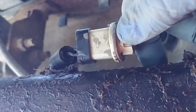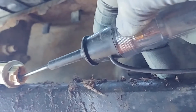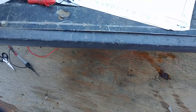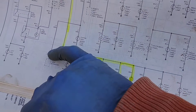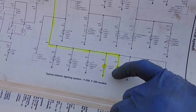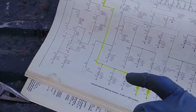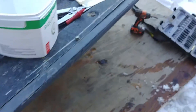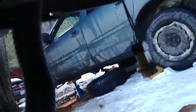Let's go to the other side and read from the brown wire, which is the bottom one. Nothing — dead. We don't have a power supply. What we're doing next is going up to the distribution where the splice is. The circuit is connected there, and because we have power at the other lights, somewhere in this area there is a break on the power side. I already found what's wrong, but I'm taking you through it step by step.